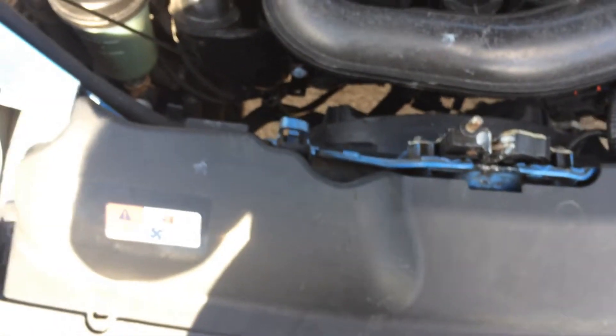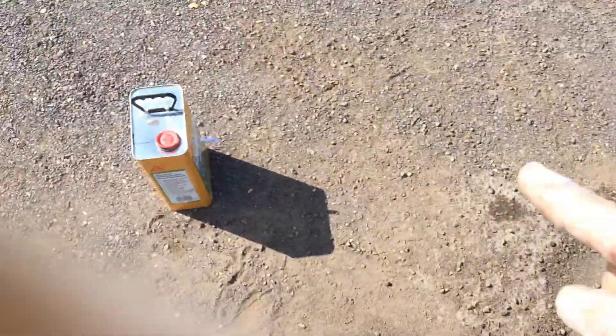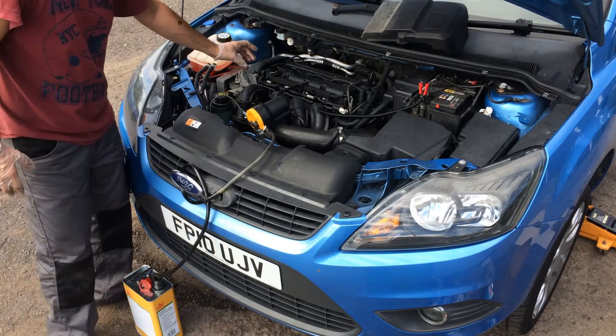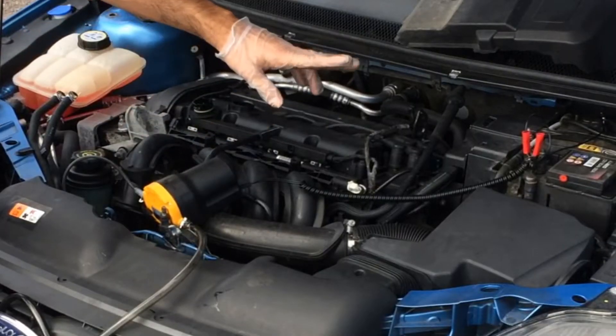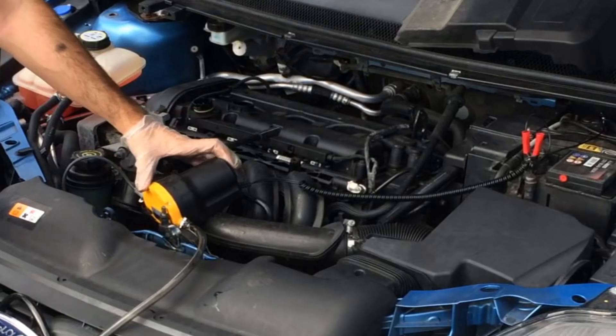Fortunately I have an electric pump where I insert a pipe connected to the battery, and it drains directly into a recipient. I'll still leave the oil pan underneath because I'll still have to remove the oil filter. So let's install and start to pump the oil from above. I'm going to set up the pump — remove the dipstick, connect the pump, and make sure it is the correct polarity, otherwise the pump will blow oil back in instead of pumping it up. Now let's go for it.